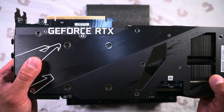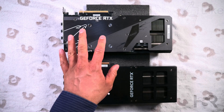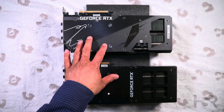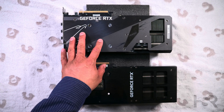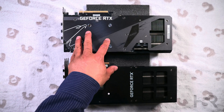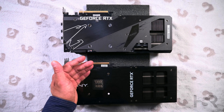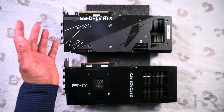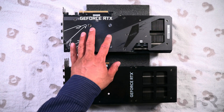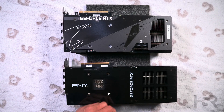It's a really good card if you can get your hands on it — really nice looking, and it looks great in your case. But I have had issues with this where the thermal paste — those are with all 3090s. They weren't pasted properly or something and they heat up quite a bit. The thermal paste gets destroyed. What was happening was as soon as I start gaming, the game would go to 144 hertz — I do 2K 144 hertz monitor — and it would drop all the way down to 29 FPS, then go back up to like maximum 59 within five minutes. It would just stutter and crash, and the fans would be on full blast. So I sent it back to them, they repasted it and sent it back to me. By the way, I've got a way to cool my GPU — let me know if you guys are interested in seeing that.